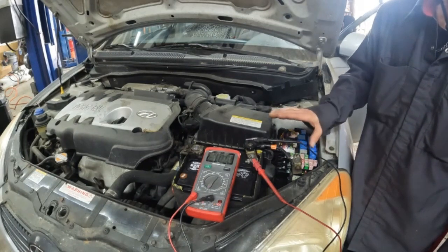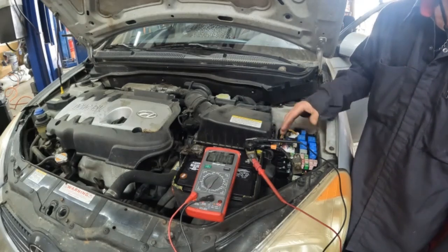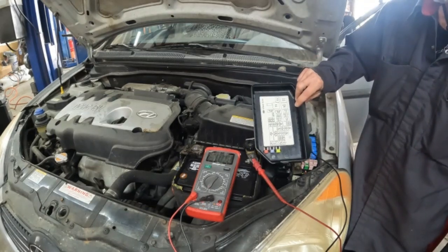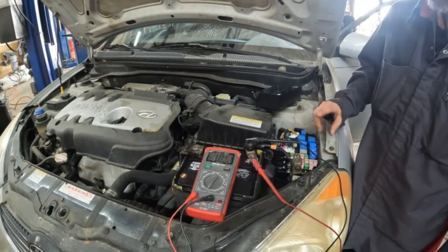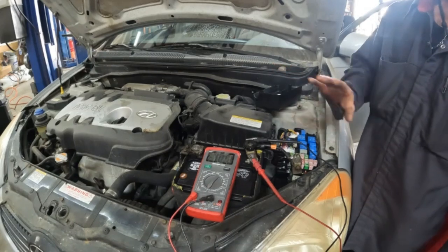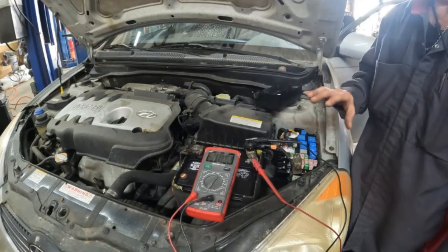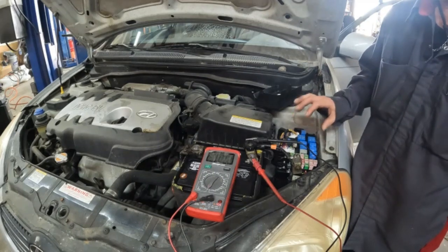The best thing to do is take a picture of your fuse block. That way you know exactly where the fuses came from, and all the relays. On some models they do give you a chart on there, but take a picture because some are not used, and you pull one fuse at a time. Do not put it back in until you are done. Sometimes it could take multiple sessions to look at and verify,